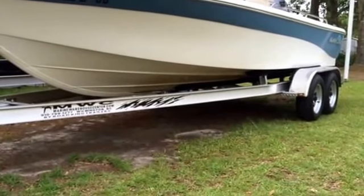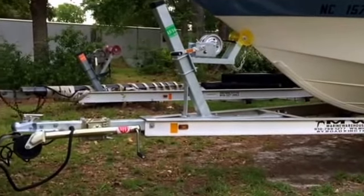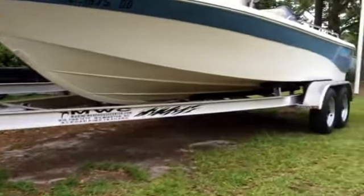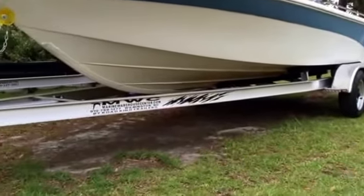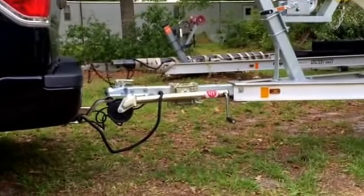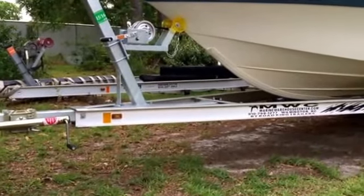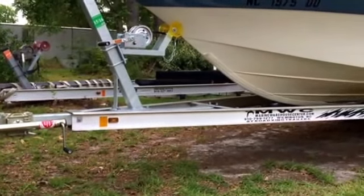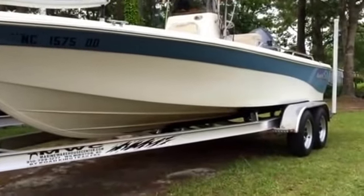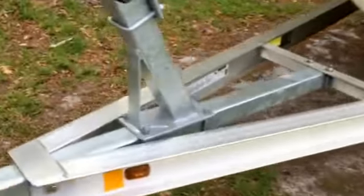All right, so this is about a week later. Got the boat on the trailer here - I've been using it, loading it, unloading it, and it's done great. I've had to flip my ball around because it's sitting up a little higher with these 14-inch tires than my older trailer with 13-inch tires. So I've got to get the right hitch, but I just flipped over my two-inch drop for the time being. Loads up great, comes right up, hits right to the bunk, sticks it pretty well so I can walk up and hook it myself by leaning over. That's my 2110 Nautic Star.